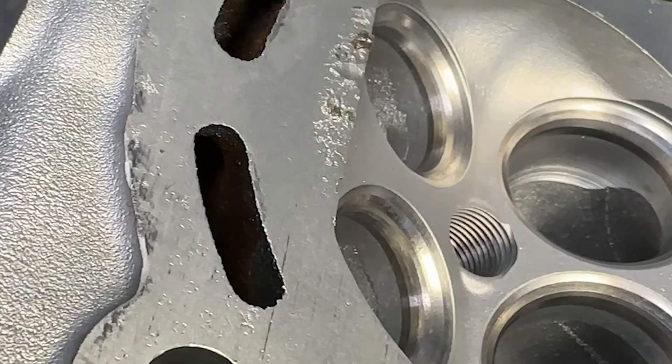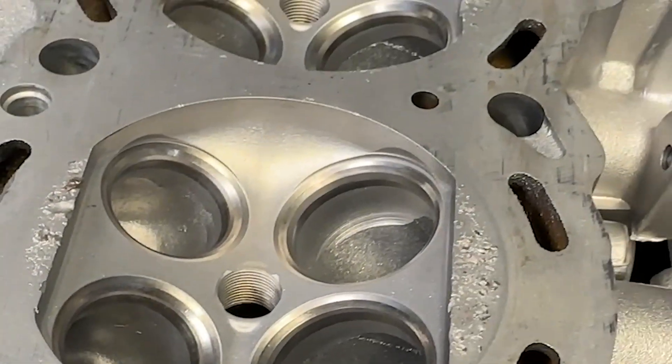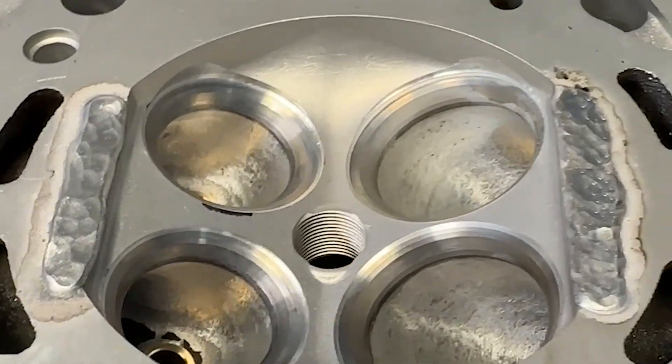They're sharp and they're sharp into the combustion chamber. What happens is you'll get these marks in the combustion chamber from the detonation, and then if you don't have a good tuner, usually it comes apart — it sprays the combustion chamber and now you have to weld it.